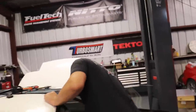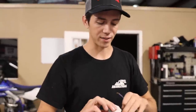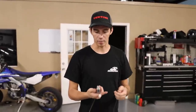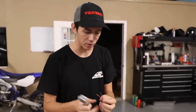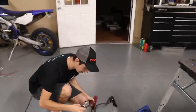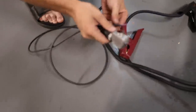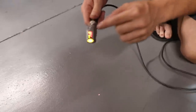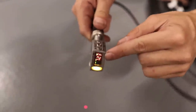They just got the Banner laser height sensor in for the MR2 to help combat wheelies. It's just power, ground, and signal out to the computer — regular 12 volt. When you power it on, it shows in real time how far you are from the ground, and the reading is in millimeters. Watch the number go up in real time as you move it away from the surface.